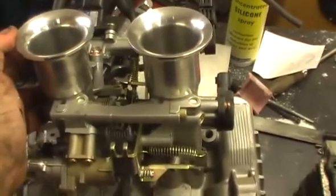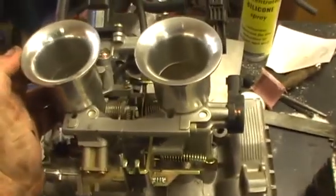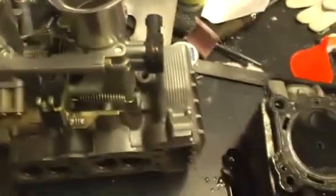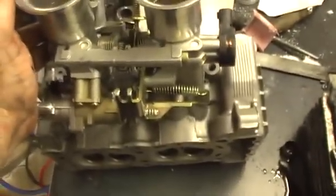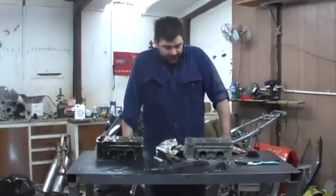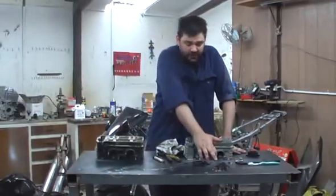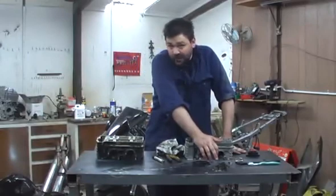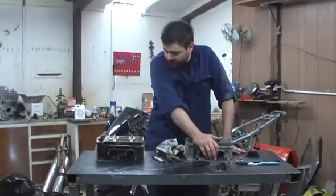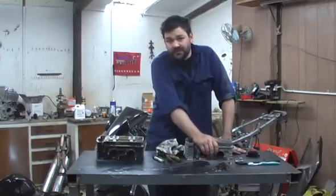Later on I will do another head and I will be flowing it a lot harder. This is purely for getting the EFI on just to test it and see how everything goes. Now begins the arduous task of actually changing everything over, locking the valves in and all the other brilliant stuff that goes with it. This is going to be rebuilding all the head. I'm going to take my valves out of here. I've already got the buckets and shims. I'll space them up with the cams later on. I'm not going to shave the head — it's pretty flat as it is, so I'll pretty much just risk putting it back on.